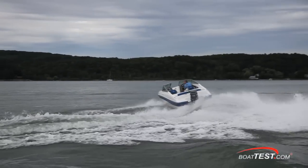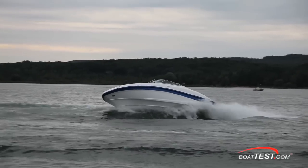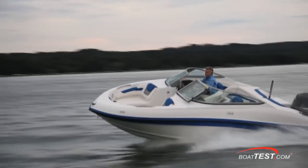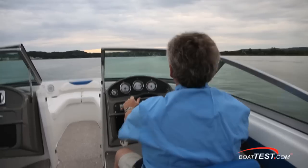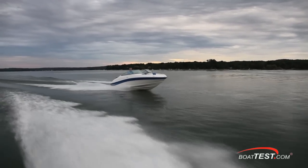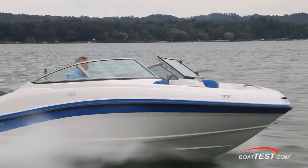For turning performance, I find that the 196 carves through the turns quite nicely, and if you put the wheel hard over, the outboard will have you pivoting around in a little bit more than your own length. When trimming the 196 outboard, you want to bring the trim up to about the one-half mark. If you go up beyond that, you'll start to get some operator-induced oscillation. You won't find spray going from the helm moving back, but you will find a boost in speed as you bring the trim up.